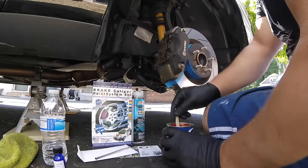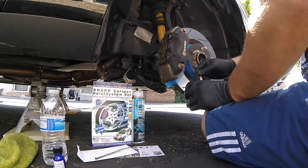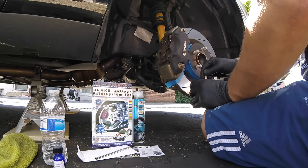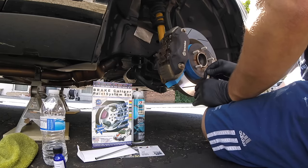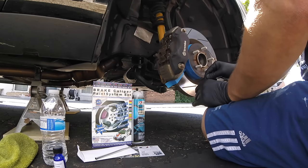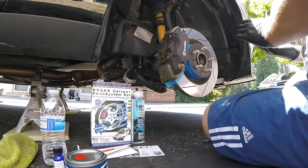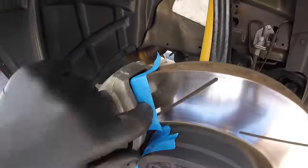Once the activator is added, you'll have about four hours to work with the product. Applying three to four good coats at approximately eight to ten minutes per coat with 15 minutes between each coat will take just about that long. The G2 kit includes paint, activator, mixing stick, brush, and brake cleaner. The brush provided is adequate for the job — just keep an eye on it and remove any loose strands so they don't wind up trapped in the paint. You may want to mask off any areas near your painting surfaces.